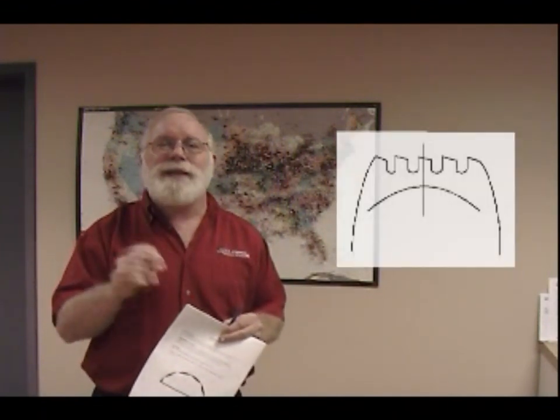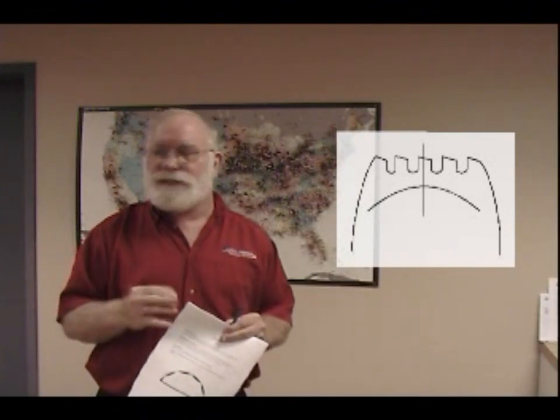Number 1 is feathered wear. The stuff we've just been talking about, sliding a tire sideways as it goes down the road. Now, if you take a rubber tire, put 6,000 pounds of weight on a steer axle, and slide it sideways down the road on asphalt or concrete, do you think the tire slides smooth or does it chatter? It'll chatter and it'll cup.